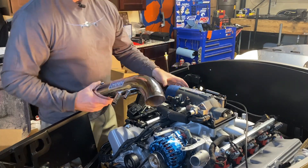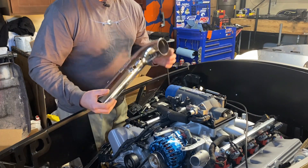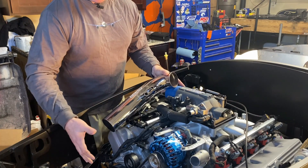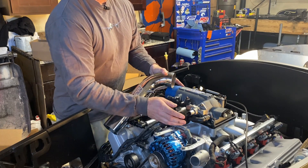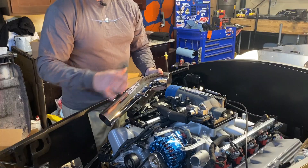So what we're going to do — with my last Cobra I brought the air filter out further, but there's plenty of space here. Since this is a 78 millimeter throttle body, this cold air intake will fit just inside there to give us the angle we need to put the filter right here. That also works well for all the hoses that connect to both the throttle body and over on the vacuum side, driver side, valve cover. So we're going to clean all this up and get it installed.